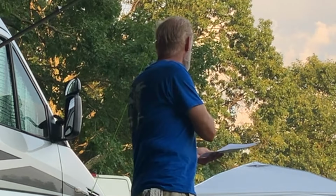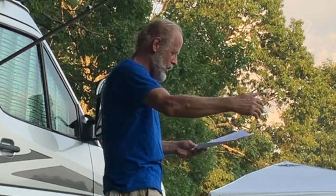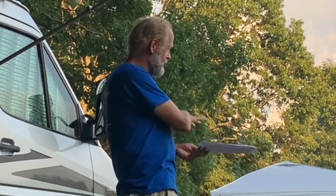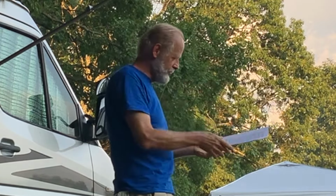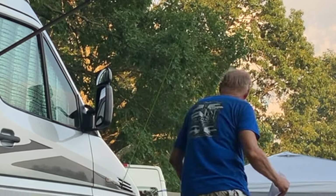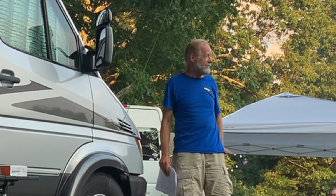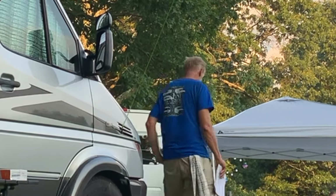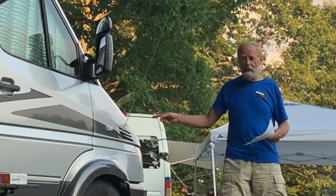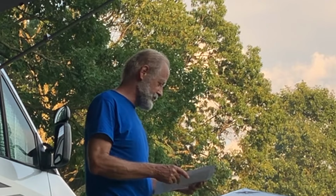So, next thing, what else can I do to improve my headlights? You can check the aim. Park on a level surface, about 25 feet away from a wall, and check, are the left and right headlights at the same level? They should strike the wall at about the same height as the headlight. Easy to check. There's the center of the headlight. Walk 25 feet. Is that where it's hitting? There are adjustment screws. Penetrating oil first and hope you can adjust them, but that could be a problem with an older headlamp for sure.